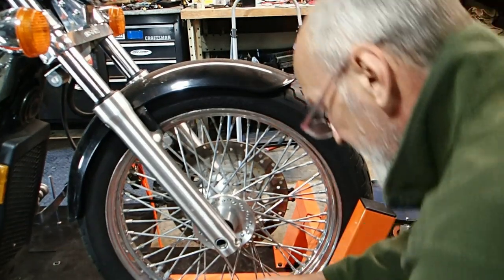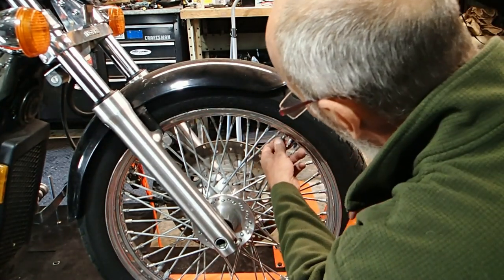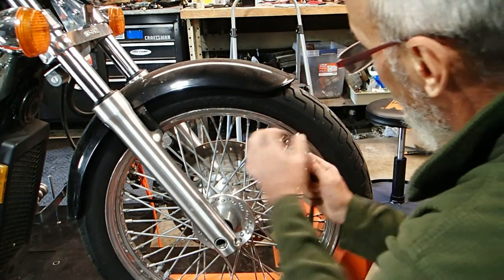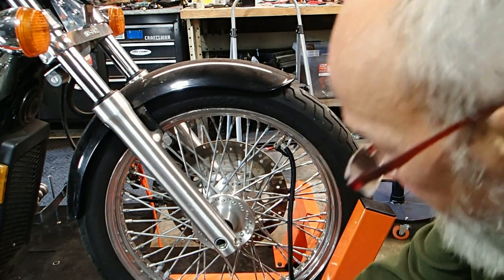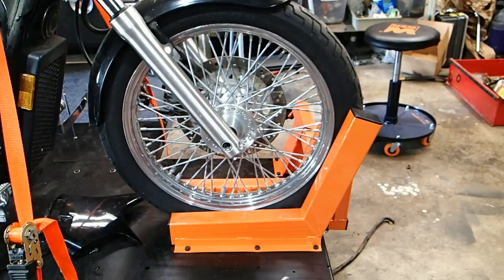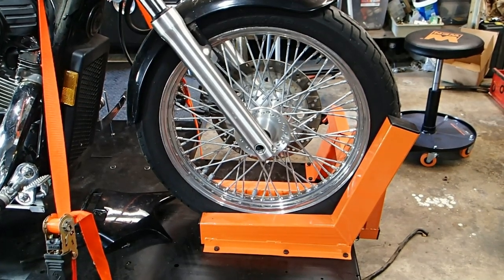Moving on to the front tire. I'm going to set this down to 30 because it always seems to cut off a little early. This one feels like it might already have some pressure — yeah, it's at 19 PSI. Air pressure's good now, at 29 pounds in each tire. Let's move on to checking all the lights and make sure everything works.